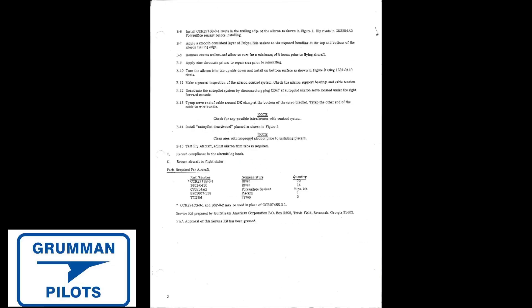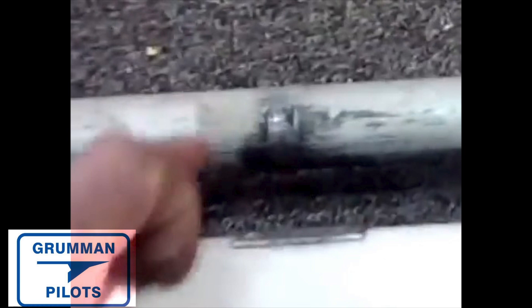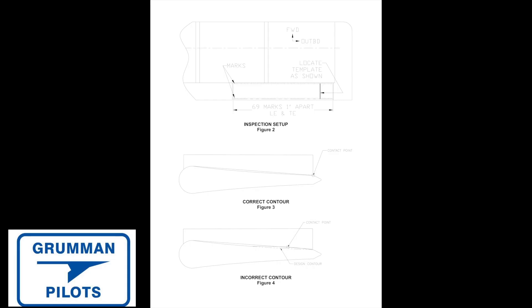Let's take a look at 06-01. Here's the full text of service kit 150 — again, not something you want to do to your aircraft. If your airplane has been modified with this AD, you'll need to buy two new ailerons to get your Grumman back, and that's going to be about $3,000 plus labor. What the service instruction says is you take the template, lay it on the forward edge and the trailing edge of every aileron, and mark them every one inch. At every inch, you check to make sure the aileron doesn't contact the template. If you pass, the recurring is gone. If you don't, you'll have to either recur, cut your ailerons, or buy a new aileron. That's 06-01, and it saves you from having to do service kit 150 to your airplane.